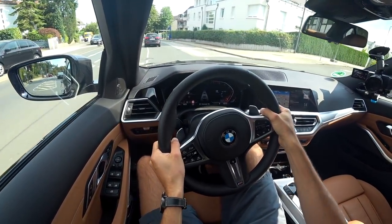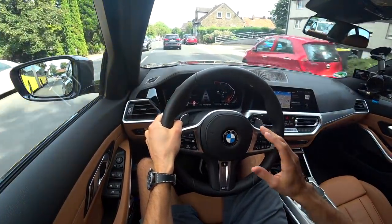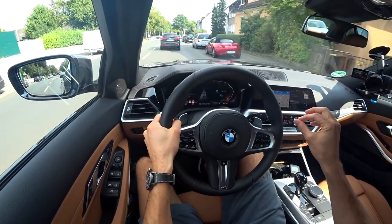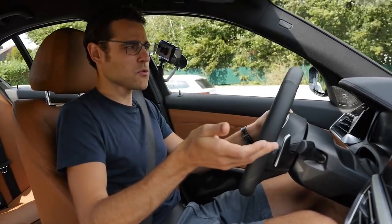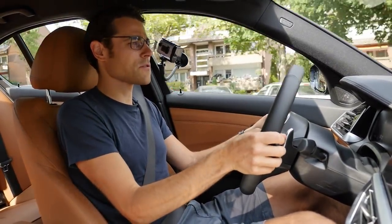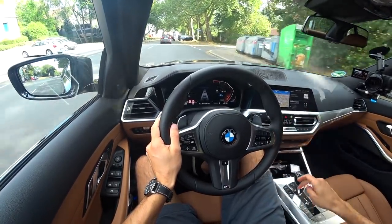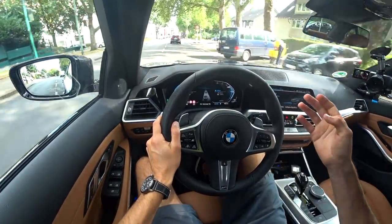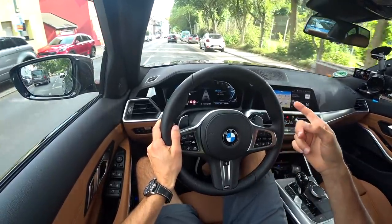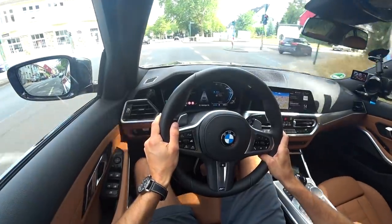It's still fun to ease this car around, and the suspension keeps it really upright. BMW most of the time has a sporty layout, even in the base model. I think they now very well master the compromise between sportiness and comfort. The fixed M Sport suspension — had it in the 3 Series and also in the BMW X2 — is so stiff that for most driving situations it's unsuitable comfort-wise. Going downhill in comfort mode, we can also go to Eco Pro mode, which reduces throttle input and enables the sailing/coasting effect — the RPMs actually drop to zero and the car just freely runs. That's definitely a good thing and improves fuel economy.